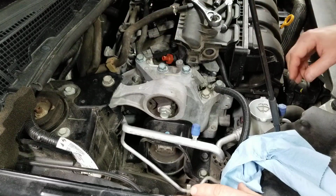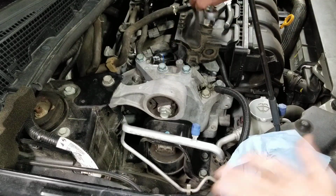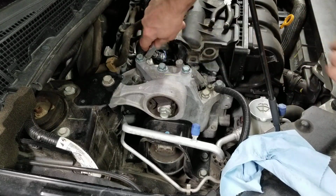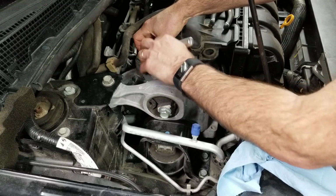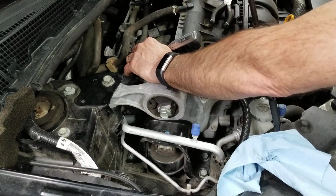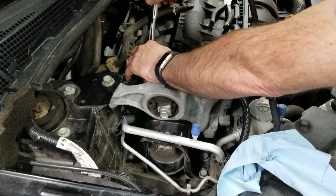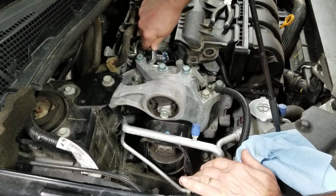So this engine's been running perfect when I drive. It's my daughter's car, but she said occasionally it'll hesitate or something, which I haven't been able to replicate. I just cleaned the throttle body. It was pretty nasty because the idle was erratic. The idle was really rough, so I took the whole throttle body off and cleaned it. And it had a huge black carbon ring, really bad. The engine's got 160,000, so I cleaned that really good with some Scotch-Brite.